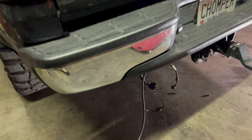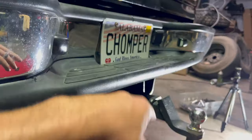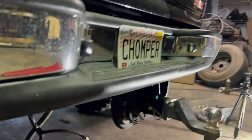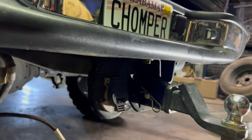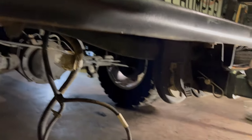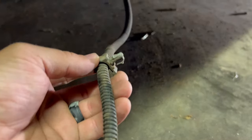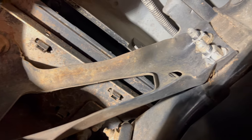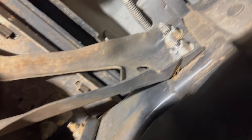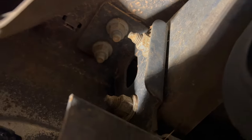So if you haven't already, go ahead and remove your spare tire. The next thing is to unplug all of your electronics from your tag lights. Take your spare tire tube out, your hitch plug, whatever, because we are going to be dropping our hitch as well. They do make hideaway hitches which we might do in the future, but as of now we're just deleting all this. It's going to be some nice weight reduction. Go ahead and take out all those little Christmas tree clips — just leave these dangling for now. You've got 10 total bolts holding this bumper on: two on each side up here, two on each side back there, and then one on each side of the hitch. These are 18 mil, and that's a 13/16.